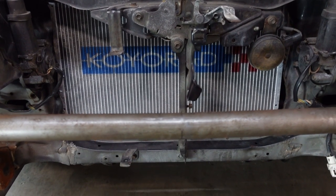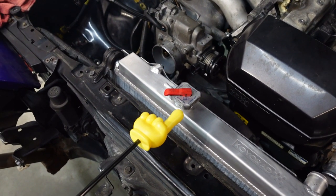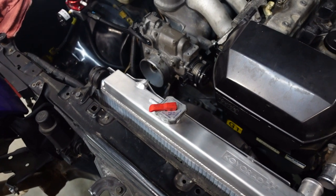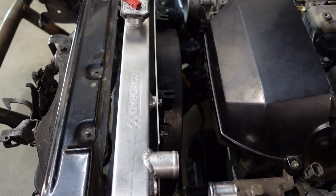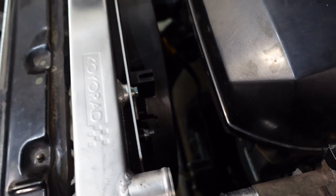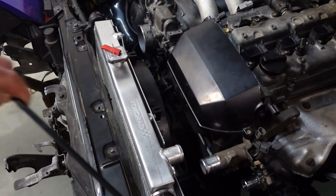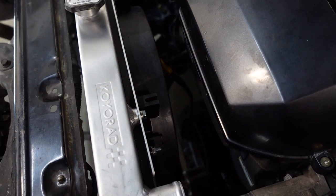Beams swap coil radiator from Battle Garage — and why don't you just provide a radiator cap? This is really ridiculous. So we're using the customer's OEM radiator cap from the 4AG radiator. Thanks to Chris Van for showing me the excessive radiator shroud and fan. All around this we have foam, because you want the airflow to go through the radiator, not out through the sides of the fan shroud. Absolutely critical to put foam all around the fan shroud.